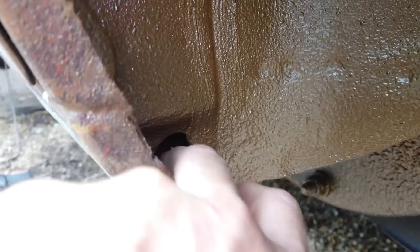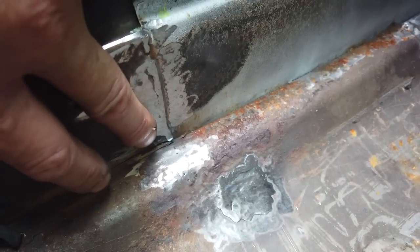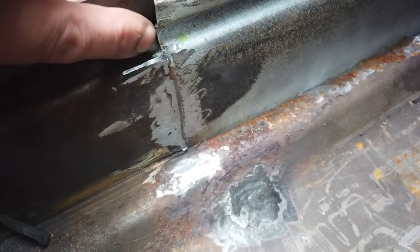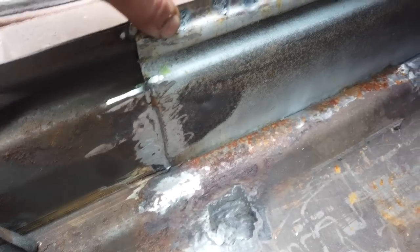This tub's done, of course. We did that. There's the inspection hole this side, remember. Then the floor pans here, just tidying up the welds. Welded together that piece, that inner sill patch repair. Of course, there's a profile difference here because that's a copy. We'll live with that. It was spot welded in, as you saw.